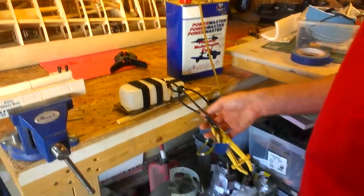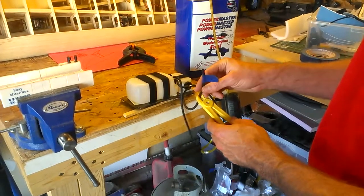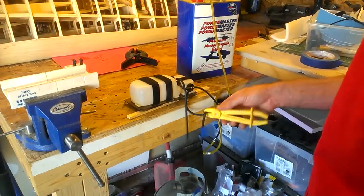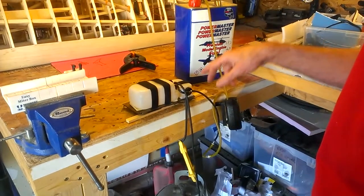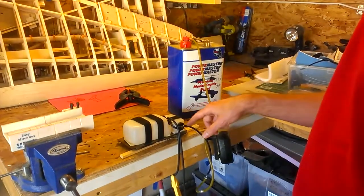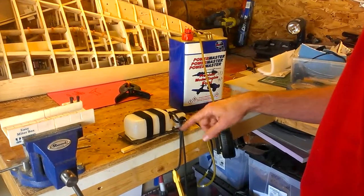This is where the carb would hook up. I had to clamp it off because when I pressurize and fill it, it was shooting fuel out of here — when it's plugged into the carb, I think it'll be okay. Maybe I'll plug the carb, who knows. I have a separate clunk, so two clunks in the header tank and one just for filling, so no T or anything.